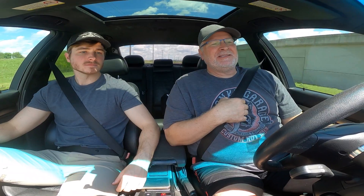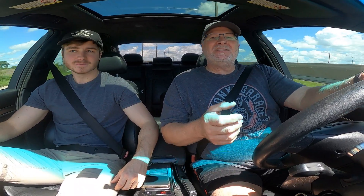It's kind of insane — you should hear it outside, it is so loud. Still got six mufflers trying to keep the sound at bay, not stupid loud. Unlike some Mustangs with exhausts so loud they want to sound like NASCAR, I wanted an aggressive sound that's not overbearing, not droning on the tollway. Inside the cabin it's actually not that bad. I redesigned the exhaust to route the mufflers and pipes back through the center of the car, similar to the stock BMW routing where the heat shielding is.